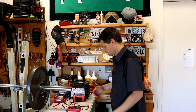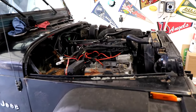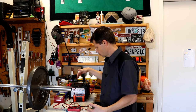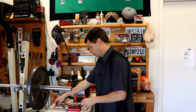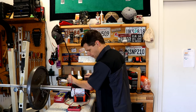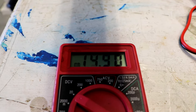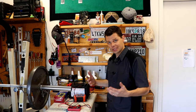And we're back. So I took this off the charger yesterday and actually tried it in my Project 92 rebuild. It was about 12 volts — it wouldn't quite start it, it was still a little bit too low. So I went ahead and left it on the charger on the repair mode overnight for another night. And now, with it on the charger, it's giving me a reading of, yeah, it's jumping around 14 to 16 volts. So that's what we wanted on this charger. So let me take it off the charger and see where we're at.